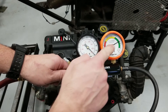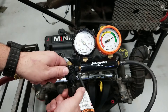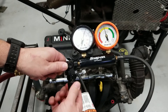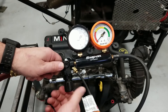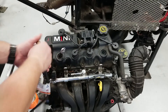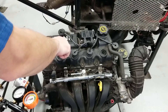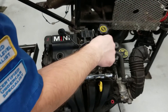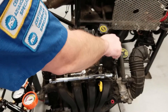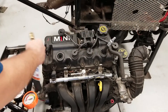Now that we've tested and recorded our results on this cylinder, we're going to try a different cylinder. This one was so-so — again, if we'd warmed the engine up we'd be much better. We're going to back the regulator off fully until we get to zero psi on the left gauge, then disconnect and move over to cylinder number four. Do not disconnect until you've backed that regulator all the way off. You don't have to disconnect the air hose from shop air, but you must back the regulator off.